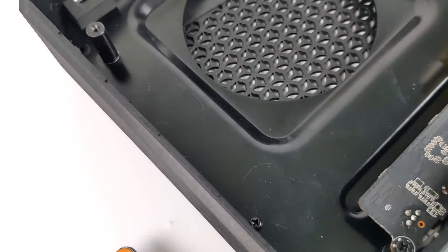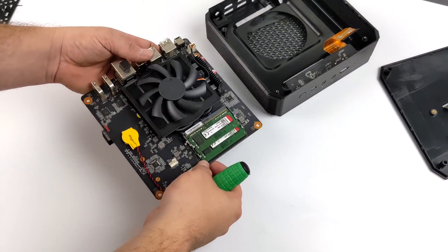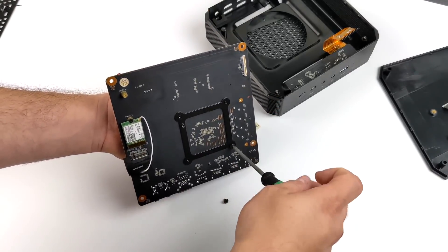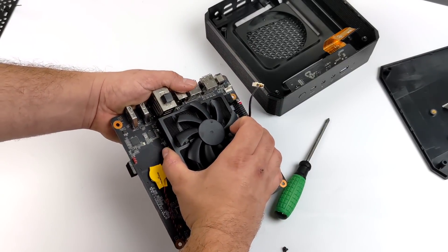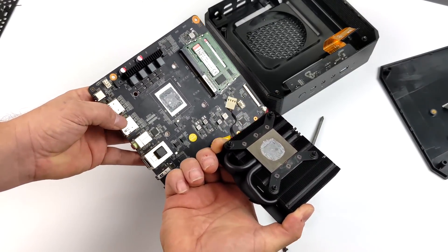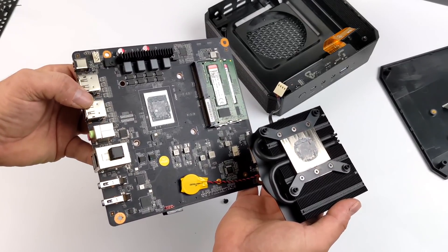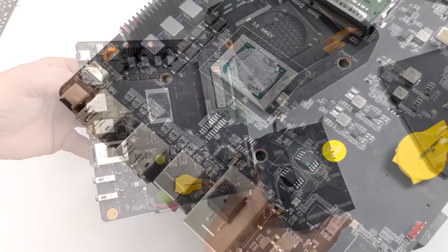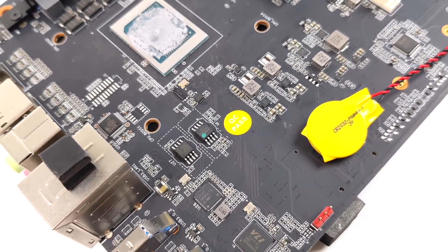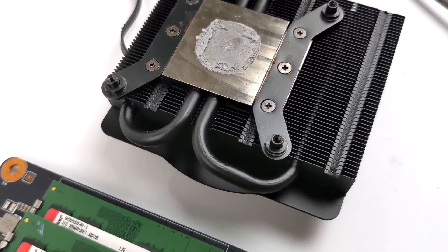That's why I'm pretty sure liquid metal was never applied to this one. Let's go ahead and pull the heat sink and fan off — we've got four screws on the backside. With those out, we should be able to lift this cooler right up. And yeah, just as I thought — regular thermal paste. It doesn't look like the greatest paste job, but it kept that CPU cool enough during all my testing. With a better paste job and some high-quality thermal paste, I think we could get a little better thermal performance. But looking at the board itself, I don't see any liquid metal — none on the back side of this cooler, and none thrown around by the fan inside the case.